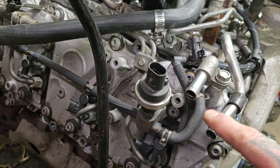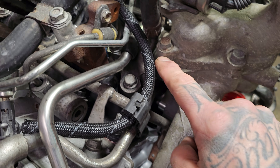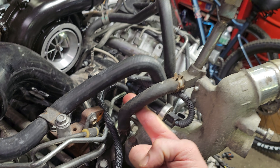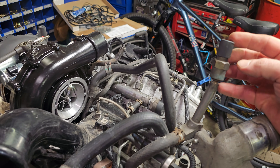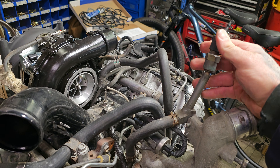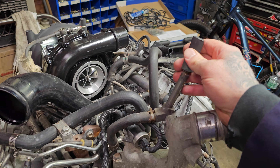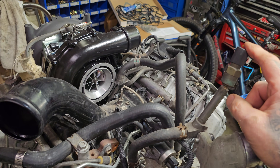So let's say it goes through the filter, out of the filter, and then it goes into this port. It's going to follow this port down, and you're going to see this vacuum test port on here. The reason for the vacuum test port on Duramax — this has been on here since 2001 with the LB7s — is to test for fuel restriction, for fuel hemorrhages if you want to call it that. If there's a leak somewhere and it's not drawing fuel up to the engine properly, you would find that and test it through this point here.